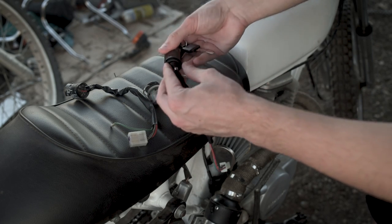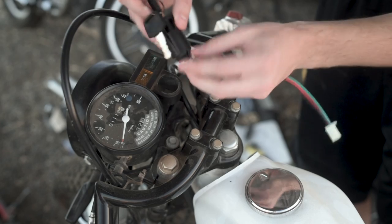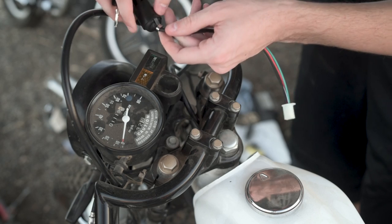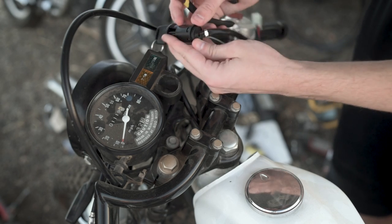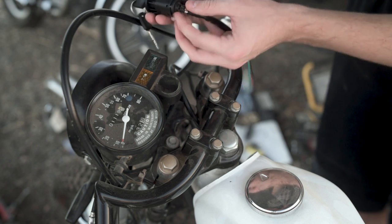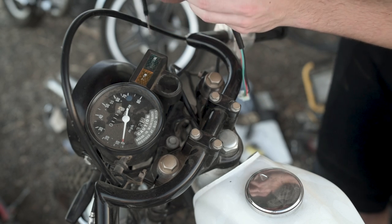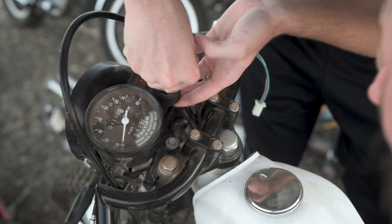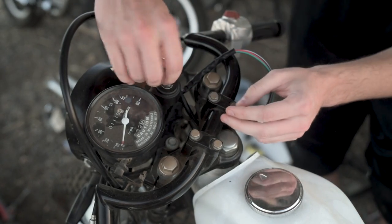This new switch is just a little bit longer than the stock switch. I was having trouble because the little bracket was touching the bottom — I need to go just a couple millimeters further. I'm going to bend this little bracket, and that should do the trick. That was actually a good fix — the bracket just wasn't crimped quite tight enough, which was why the rubber boot was coming out.